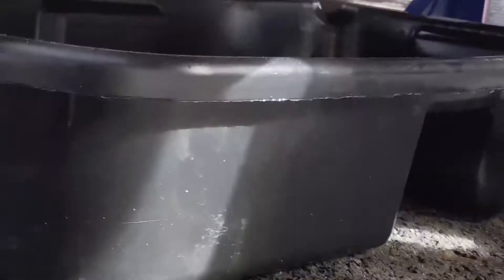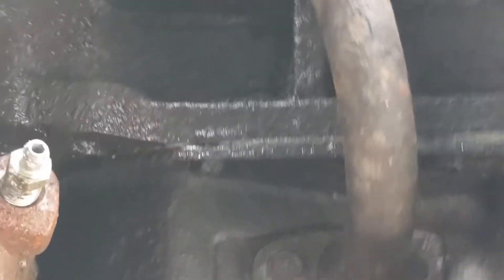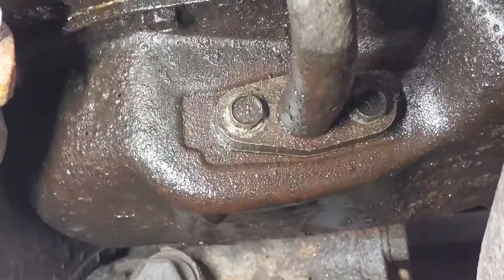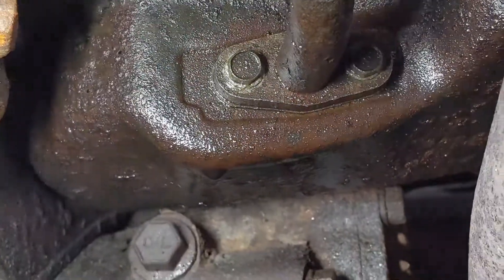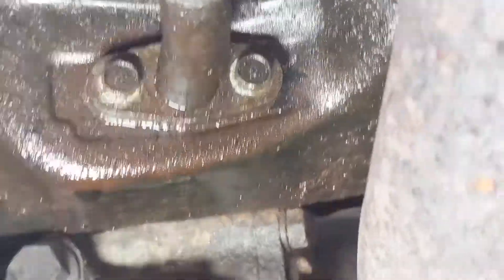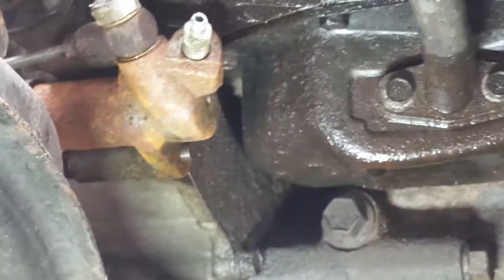Now that we've got this thing up in the air, we're going to take out our drain plug with an 18mm. As you can see it's pretty wet right there at the oil return where it meets the pan - I've noticed some drips coming off of it, so obviously she's got a leaking issue. You can actually see a drip right there on the bottom of it right now.